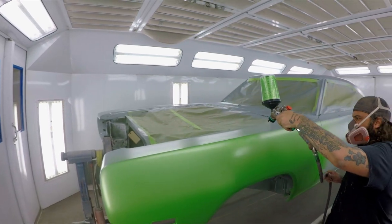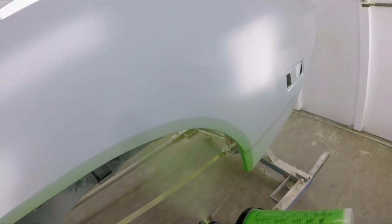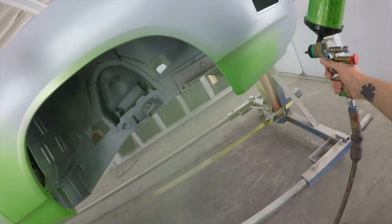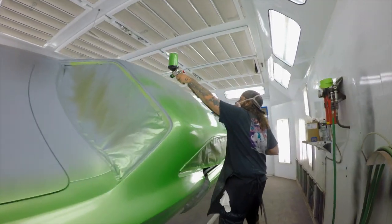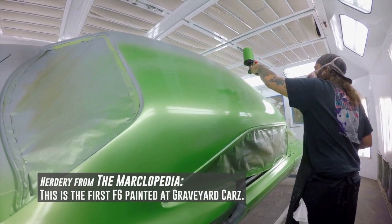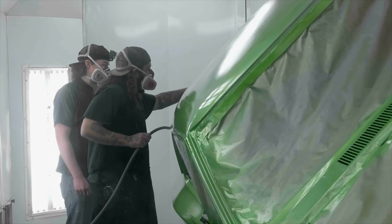Then on top of it, it's a metallic, so the prep work needs to be spot-on perfect so you don't have any sand scratches. You've got prep work that has to be great. You have to take into consideration it's a super transparent color, and on top of that it's a numbers-matching car — all original, gorgeous car. The stakes in the paint shop couldn't be any higher than on this car. It's one of those paint jobs where you just can't rush anything — take the time, do the steps, and the car will come up nicely. I have to give Will credit; he did a fantastic job getting his head around the quality needed and following it through to the end.